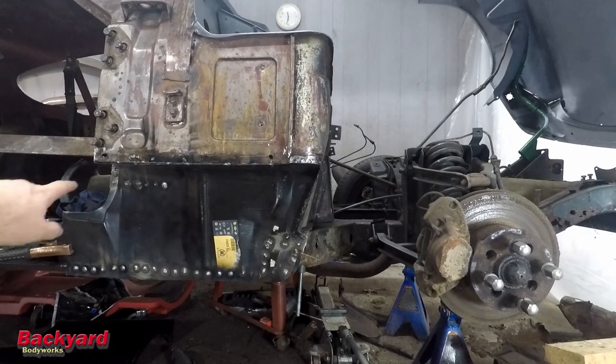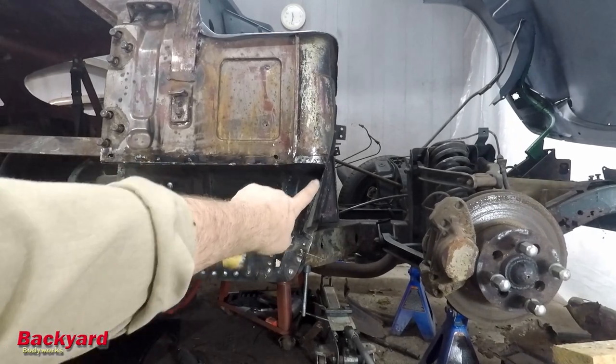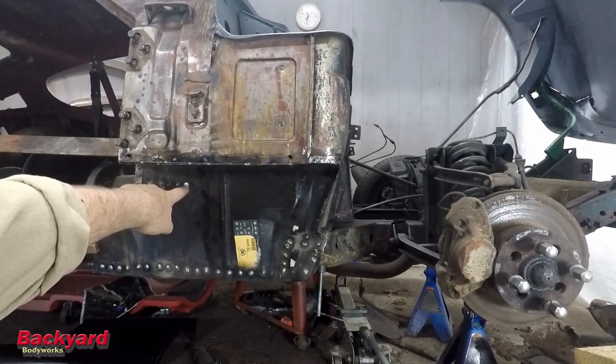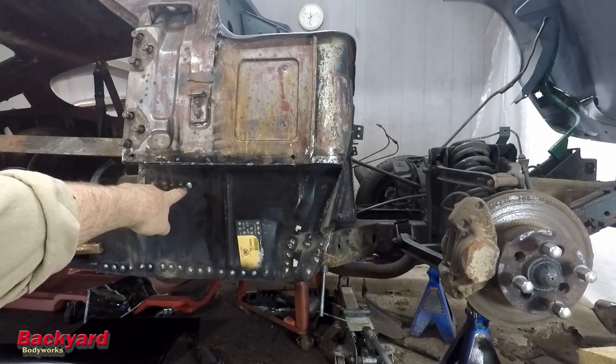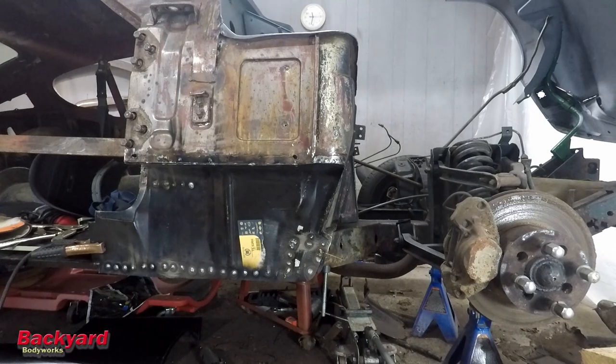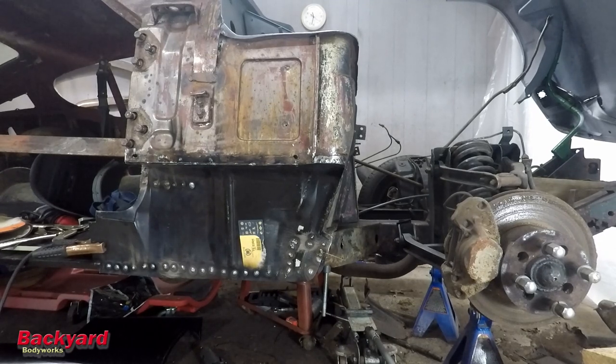I think that's got it for right now. I think it looks pretty good. I've got it welded along here. The welds down through here are all in. I got the weld here and the weld across the lower upper A-post. I probably should go ahead and weld up through here, but I'm not going to do that just yet - I want to wait. Other than that, I think it looks really good. I am very pleased with the way it welded up. Looks a lot better than that old nasty rusted brokenness that was part of this. I am very pleased indeed.